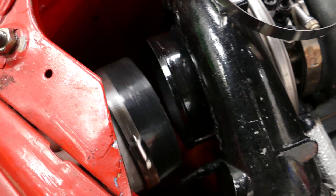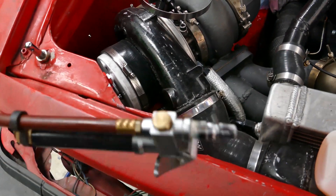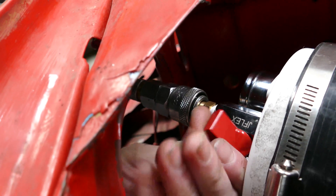This really couldn't be simpler. Here we've got our boost setup, and here's the front of our turbocharger — the inlet to the turbo right there. It's just a case of pushing this on. It's probably easier to do with two hands than holding the camera, but it'll go on. Once it's on, you normally have a hose clamp here — tighten that hose clamp up and you're away to go. If you're using the valve type, just use your normal tyre inflator, connect that to your air compressor, push this on, and put air into the system. Otherwise, just use the air hose, push it in place, connect on, and use the valve to regulate air pressure.